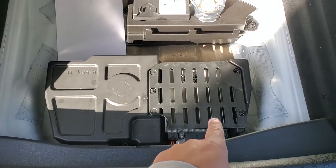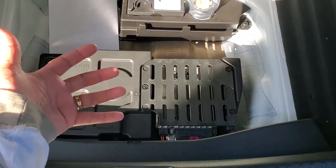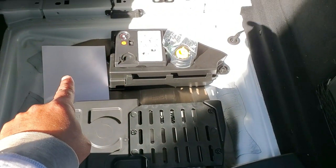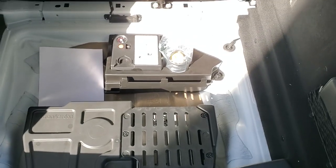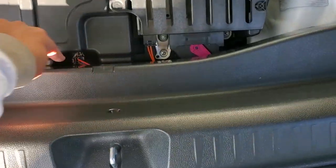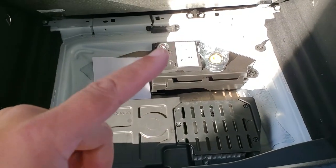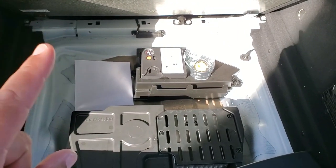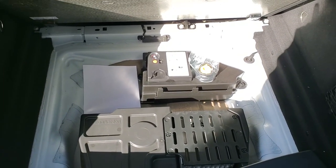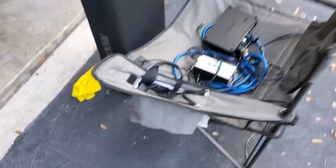Here is the factory amp. This is a big little 6-inch subwoofer — it goes underneath the amp. We're going to leave this in. We're probably going to take this out and put the amp and the crossover or signal-gathering piece here. And we're going to tap the wire that's plugged into the sub out and feed that into the LC-2i, and then get the amp.